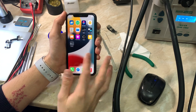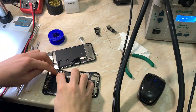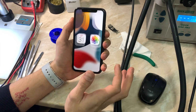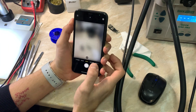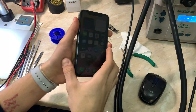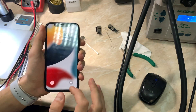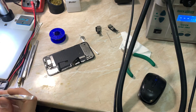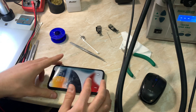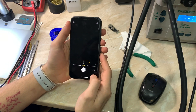Now I'm going to test the original Face ID front camera, but without connecting the front camera connector, just to make sure we don't have any problem with the infrared camera. I know it's probably not a problem, because they have both different lines, but just in case. Also, I didn't mention any software solution, because I haven't faced a problem with completely non-functional cameras due to software — and Apple fixed this in iOS 15 anyway.